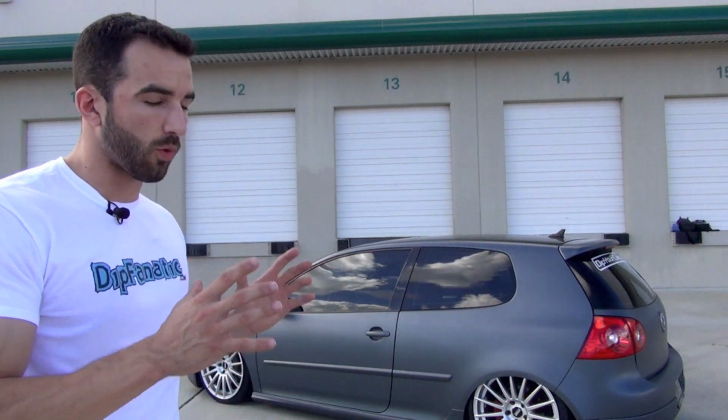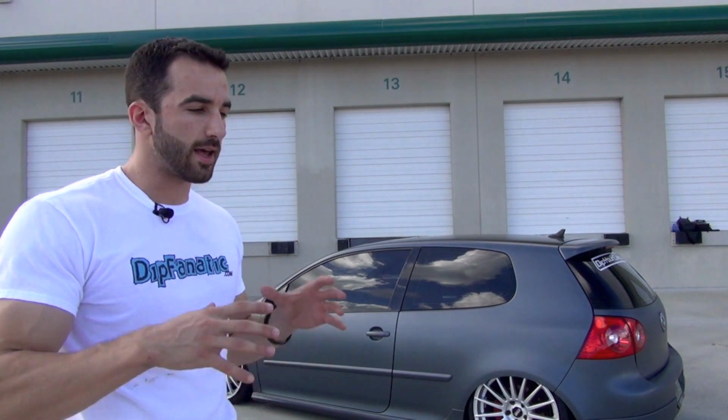Here's the end result with the metallic shadow blue. Remember, we started with 3 coats of gunmetal gray as our base coats. That's the best thing and most cost-effective thing you can do when you're working with the true metallic gallons. Then we took 1 gallon of Anthracite Gray, half a gallon of Pearlizer, half a gallon of Glossifier, and 3 blue tints from the DipYourCar tint kit, and mixed it all together.